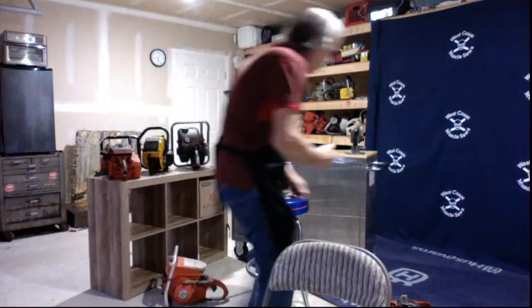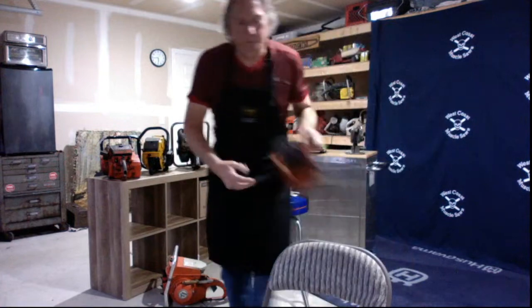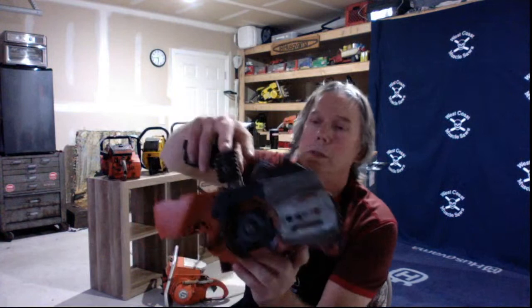What you're going to do next, of course, is enlarge the exhaust window, and then you're going to do also the intake side of the cylinder. On the intake side, you're going to enlarge it too. How much? Well, then again, it's back to experimenting till you get your pattern. You'll play with 2 or 3 cylinders till you run it and get the performance you want.